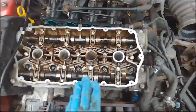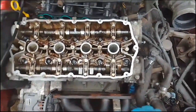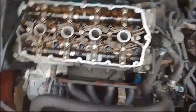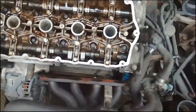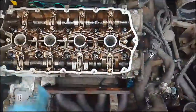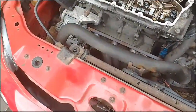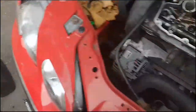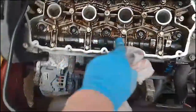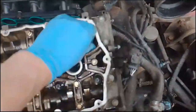Right, let's carry on. Okay, so I've put the gasket on. I've put the shim on top of that as directed by the instructions. I'm now at the stage where I've put the head on top, and now I'm just putting the bolts into it. The new bolts. I had to oil the new bolts. I don't have any real oil, so I've had to use my catchment can over there. I've had to move the cams again, so I've got access to here, but I'll have to redo the timing marks before the belt goes back on. It's just now a matter of tightening these up.